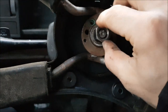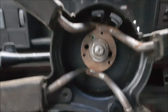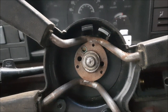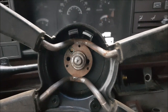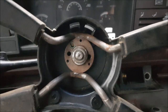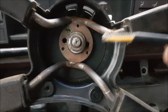Next is your nut — put that down on there. I have to go grab my torque wrench. I looked up the torque specs on the steering wheel: it's 29 foot-pounds. Not worth it for me to go out in this torrential downpour we're having to get my torque wrench, because that's not a whole lot of torque, so I just tighten it up by hand. It's splined — it's not going anywhere.